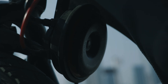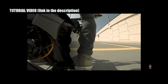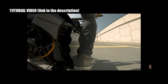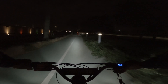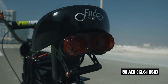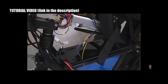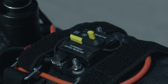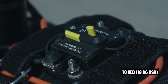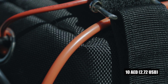I installed a Helihorn — I find it really loud but it has to be installed with a relay. There is a 5-inch headlight which is super bright, a motorcycle taillight, and a controller storage bag. I also added a circuit breaker for protecting the components from overload, overcurrent, or short circuit. I used 10-gauge silicon wire for extending the battery output towards the controller.